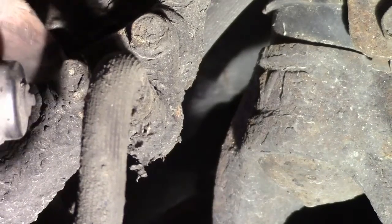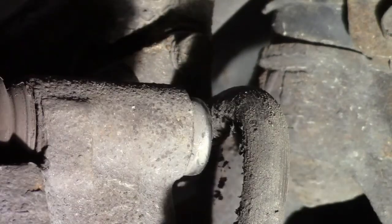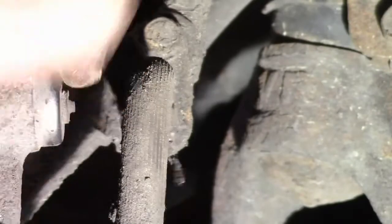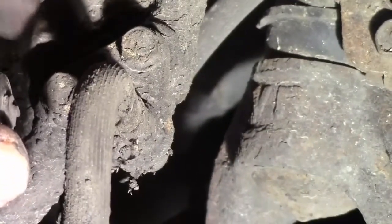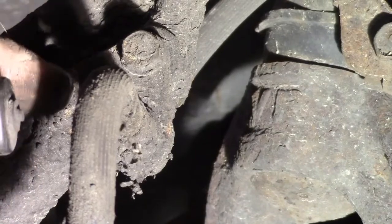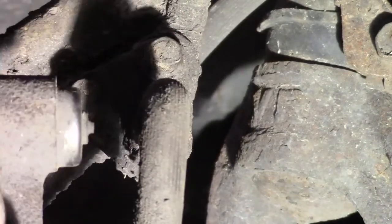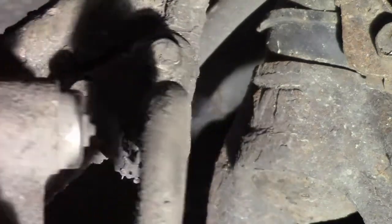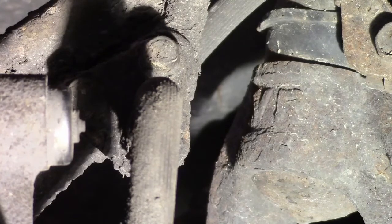For the time being, I just stuck my brake caliper back on that pin because there isn't room to tie it off — it still has these clamps holding it on. The next thing we're going to work on is there are two bolts on this bracket that go into the steering knuckle, right in here and one there. Let's just hope they come out without having to torch them up and get them hot, but let's see what happens.